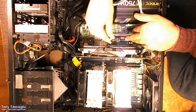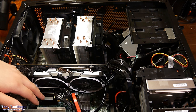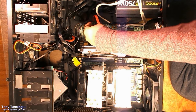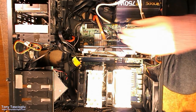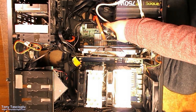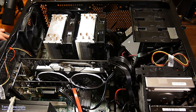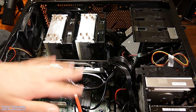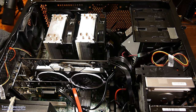I'm just gonna use the 3 on this side for sheer convenience. I could use the ones on the motherboard. I just want to do some more extensive testing first, make sure that those ports aren't broken so I don't end up frying something else. The ones on this side should be good though. I'm a little bit iffy on the chipset ones, so I'll have to test those first. To be fair, the other 2 drives that were plugged into SATA are still alive and working well. It's just that one SSD, but it's left a bad taste in my mouth, you know.